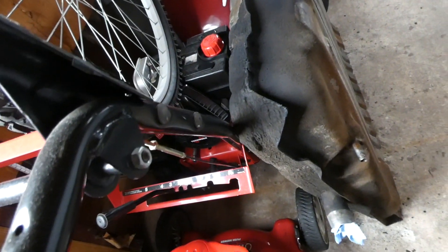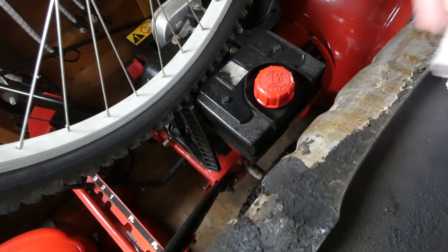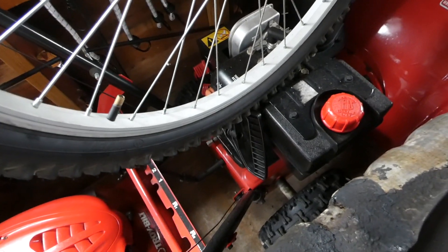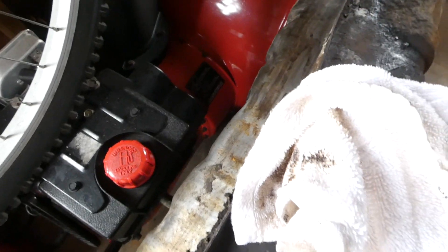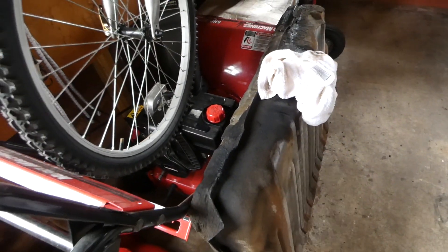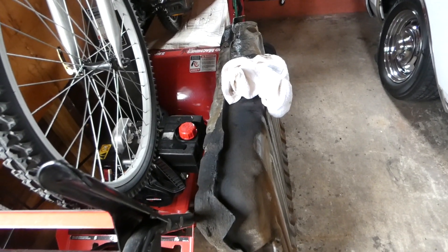RW carefully peeled a little piece of mat off the top of the tank. The car was rust-proofed at some point in its life, so the tank has basically been coated. You can see where it was leaking — this is the bottom of the tank right here. The fuel was going down this line. These two parts are where the straps go through, and that's where the straps go around back up to the car. Notably, there was no undercoating where the leak was, and that was kind of an indicator of where it was coming from.